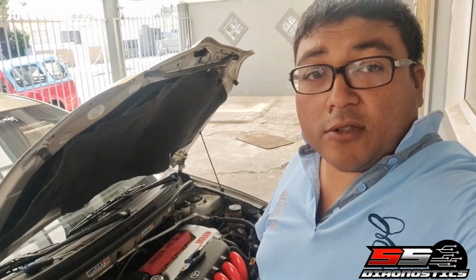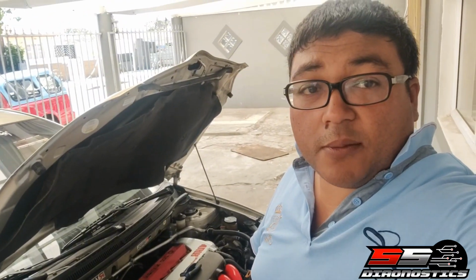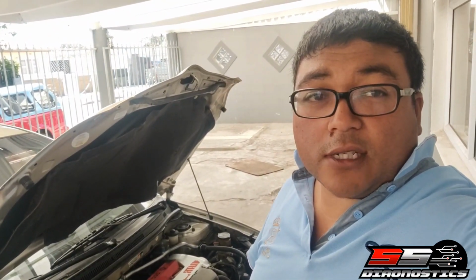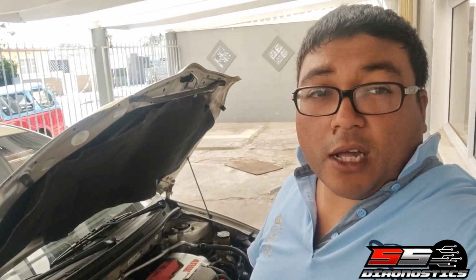So today I just want to clean my ICV. The idling is a bit uneven. My car sounds like there's a cam in. So I'm just going to check the ICV and check if it is the ICV.